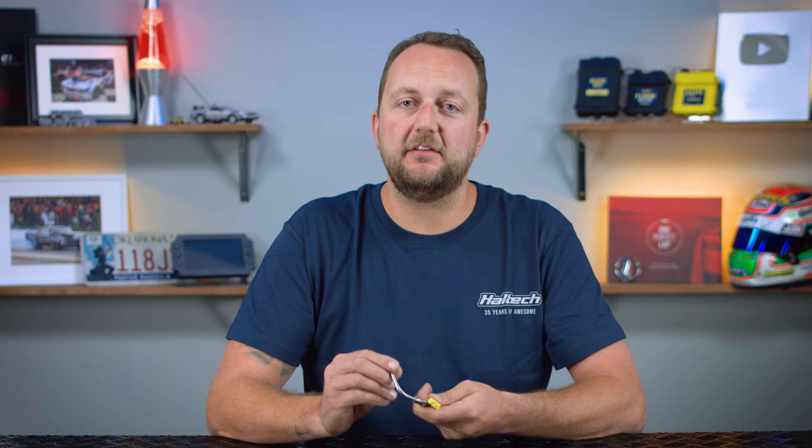So we rely on an external controller that integrates with the engine management system via the CAN communication system. We've got a separate video explaining what the CAN communication system is. It's amazing to think that these sensors have a working range of 1500°C, are two dissimilar metals bonded together to make a tiny voltage, then amplified for the ECU to see and maintain a maximum error of less than 2.2°C, or less than 1%. Absolutely amazing.